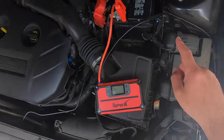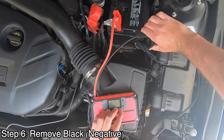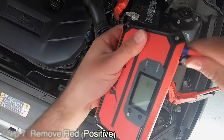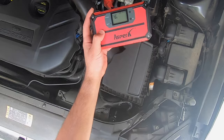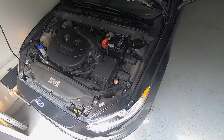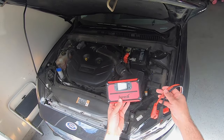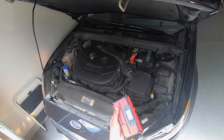Let's go out here and take them off. You do want to take off your negative first and then your positive. So let's go ahead and unhook the negative and then unhook the positive. Now we can just unplug this part right here, and it's still got 98% battery life, which is really good — it's enough to jump the car a lot more times, no problems. Now you do want to let your car run so that your battery can charge up. I will link this battery pack and some similar ones in the description box below. Make sure you hit that thumbs up button, and I'll catch you on the next one. Bye bye.